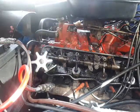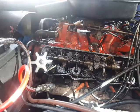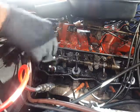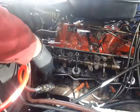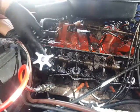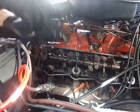I can tell you that here on the exhaust side, they have more grooves in an original way, you see. So if they are really sticking and you don't see any possibility that it comes loose here inside because it sticks, then put more pressure on the cylinder bank so that the valves really do not go down, and make some knocks on the top very lightly until the spring goes down and the retainers are free. So that is the job.